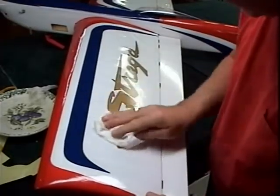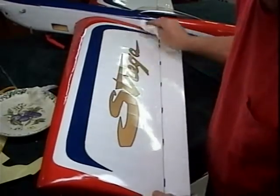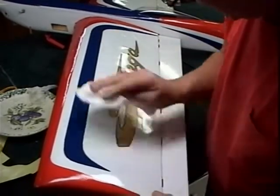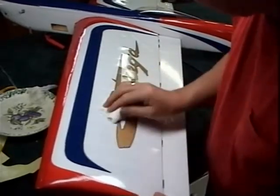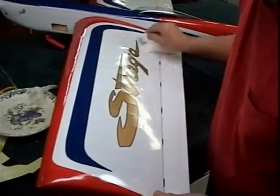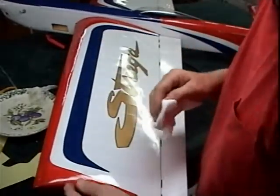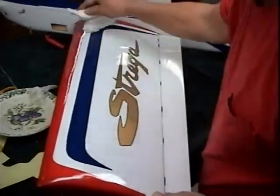Now, from this point on, there's really what I call pre-flight stuff, not bench trimming. We've got a whole DVD on bench trimming and locating the CG and things like that, but what we sure want to do, before I go to bed tonight, is put a good pre-flight on this. Go around, tighten things up, work the controls in a little bit more. Make sure things like the lead-out guide are tight, that we haven't had any issues.